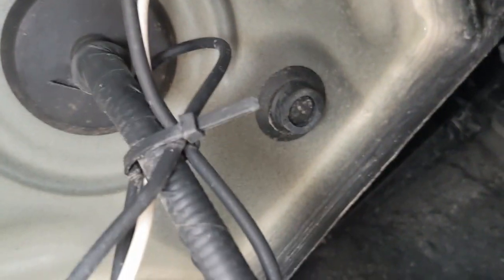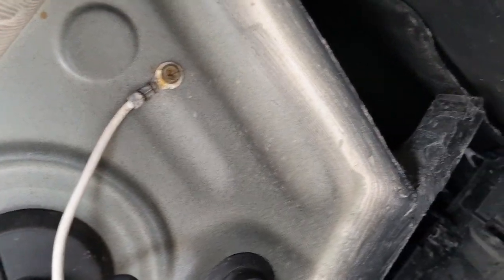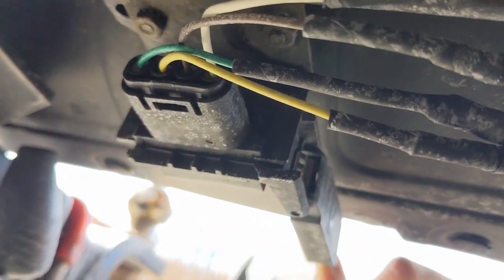Looking from the underside of the car, that's the receiver, and it's connected to a white ground wire that you want to connect to the frame somewhere. There's also a black wire coming off of it that we're going to run up to the front of the car — it's going to connect to one of the terminals at what I'd call the connection hub up front. Then these other wires relating to different functions are going to come over to the plug for the trailer wiring.